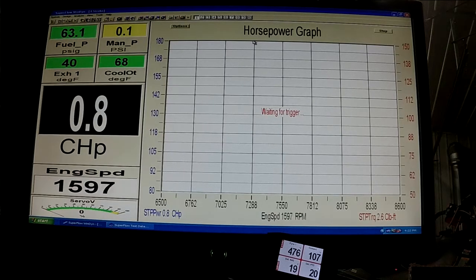Alright, we're going to go into our 2018 Axys 800 Bikeman Stage 3 validation test here. We're going to start with a cold pipe. You can see the pipe right now is about 450 degrees, engine's 105. We'll get that pipe well into the 1200s and run the coolant up into the 120s, 130, and we'll just prove that our stuff is consistent.